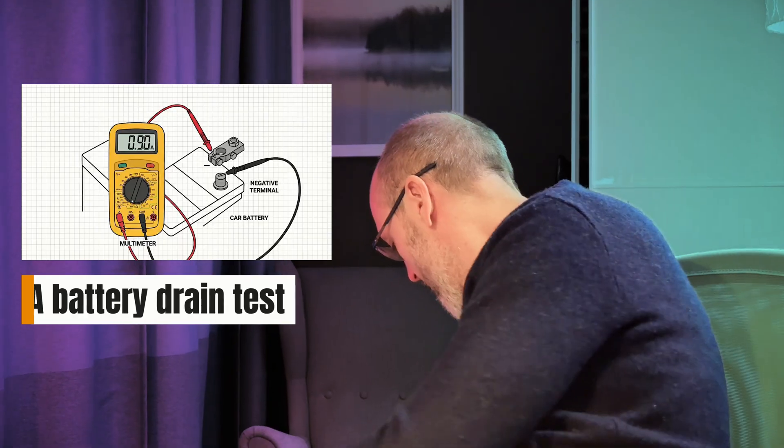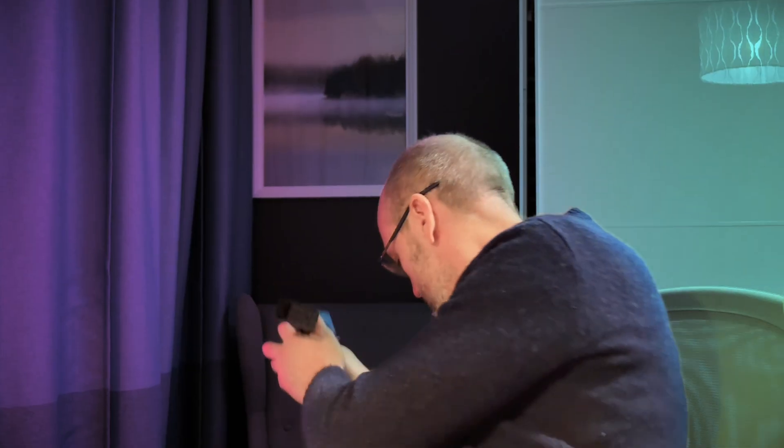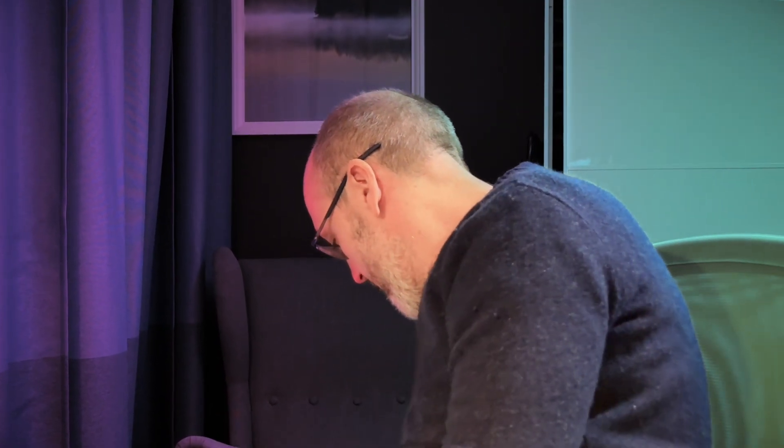There are many ways of doing that, but I still prefer, for absolute accuracy, to put one of these in series. The other ways — in my little toolbox here you can use amp clamps. These are off my Hantek scope, and I've got a KPS one, which is quite handy, but it's not very accurate; there's too much noise on it. You can measure this with an amp clamp around the thing like that, but you have to zero it every time, and I've had these as much as 100 milliamps out. When you're dealing with something that's only going to be drawing 50 to 70 milliamps and you're showing 170 milliamps — in reality it could be 70. It's good, but it's not so good for automotive; there's too much interference.